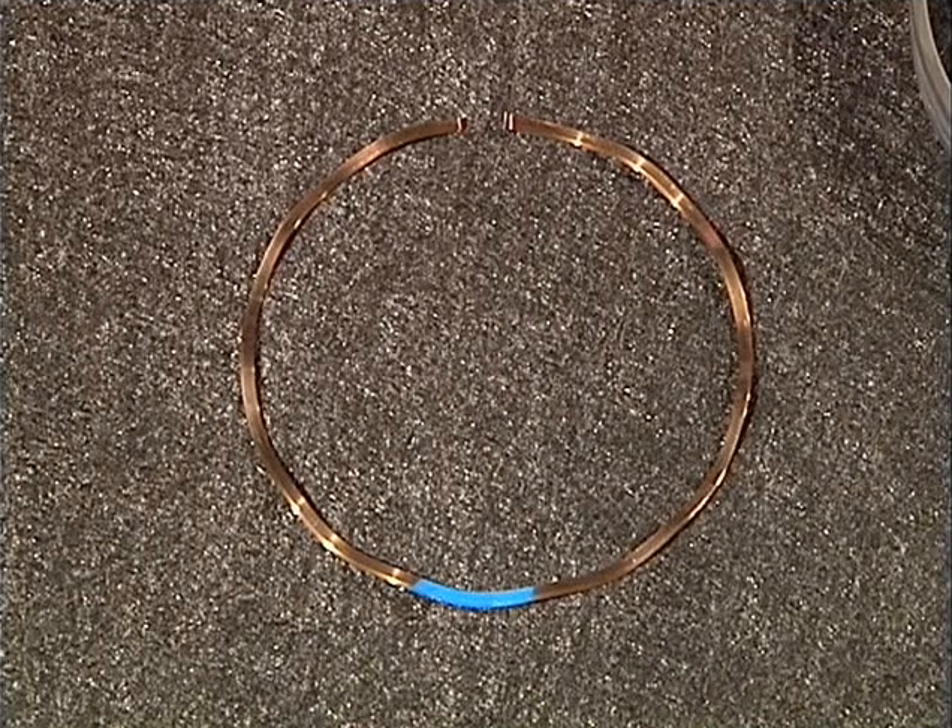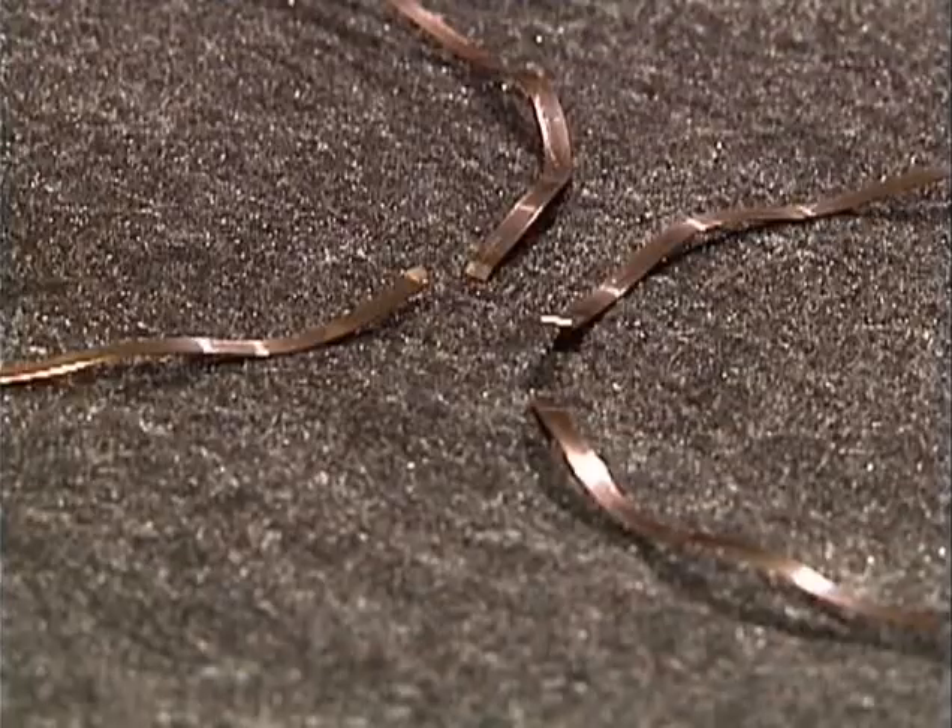The colors on used springs may not be visible. Each oil ring spring has a round and square tab on its ends. The square tab locks into a square opening on the bottom of the oil rings. The round tab locks into round holes on the rotors. These are designed to keep the oil rings from spinning in the rotor.